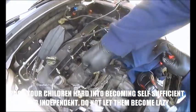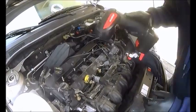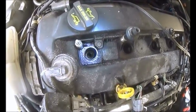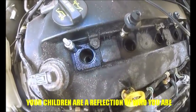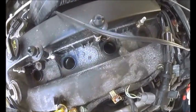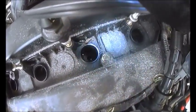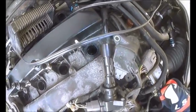So what we're going to do is a head gasket on this car. But before we go any further, I forgot to show you — look inside there. See that? The oil in this crankcase is filled up with water, big time.